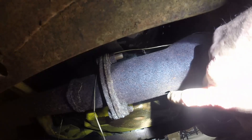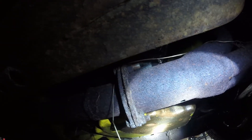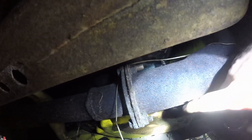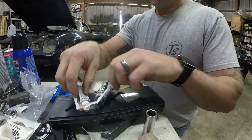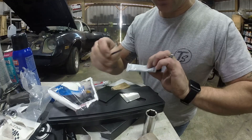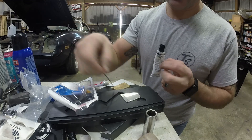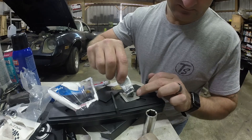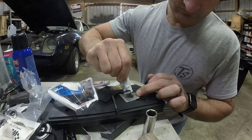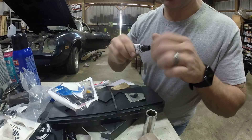Alright, here's my little hole. This stuff's really too thin to weld on the way it is, so I'm just going to wire wheel around it and then get the JB Weld ready. My shop's a mess. Anytime I use JB Weld, I like to keep my zip tie ends to mix it with — I think it makes good sense. So I'm just going to put a nice little layer, take this on there, press it on and hold it — it should stick good.